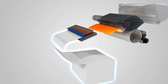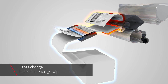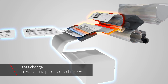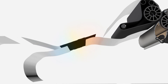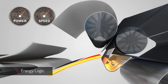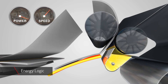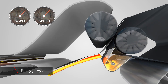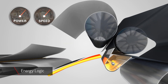Another truly innovative technology is heat exchange. Heat exchange closes the energy loop by cleverly recycling energy used in the imaging process — exiting printed sheets are cooled and incoming sheets are preheated in one single process, saving energy on both sides. The VarioPrint 140 series also features energy logic technology, which provides a very fast warm-up time of 2.5 to 4.5 minutes and a fast first print-out time of 5 seconds. It also provides optimal productivity on mixed media jobs by dynamically measuring and adapting the fusing temperature for heavier weight media, allowing it to maintain quality while helping eliminate the need to stop the engine to adjust the fuser temperature.